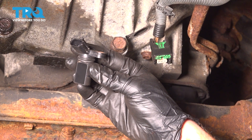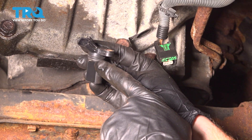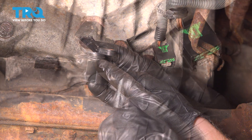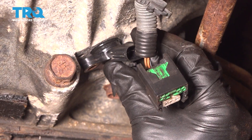It's time to install our crank position sensor. Looking along this area where the connector is, you're going to find that you have an O-ring making its way all the way around. It's a good idea to lubricate that. Once you have that gasket lubricated, continue on by sliding it up into the transmission.